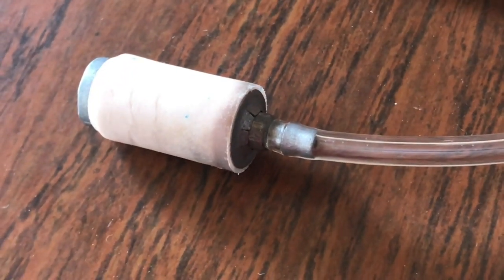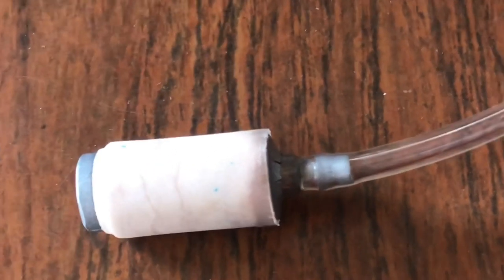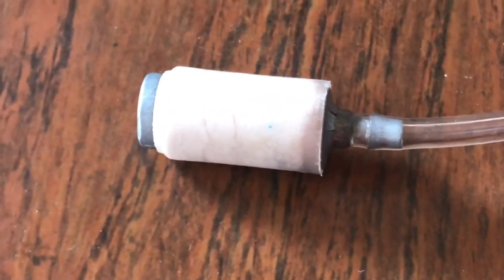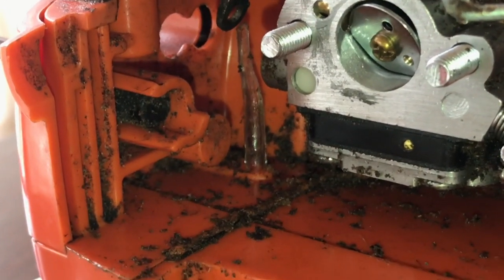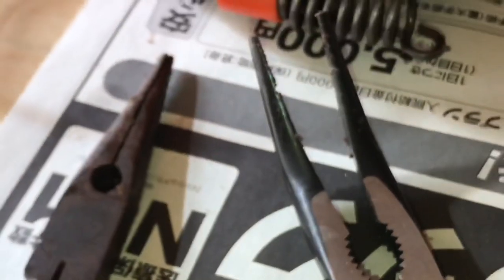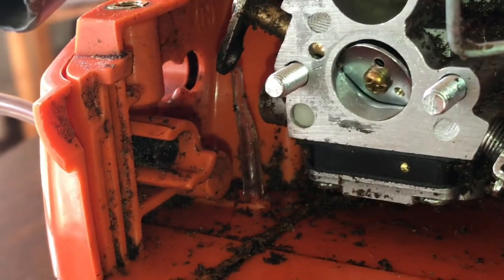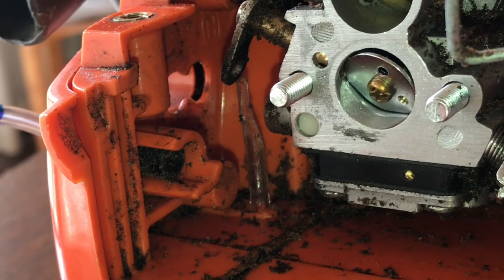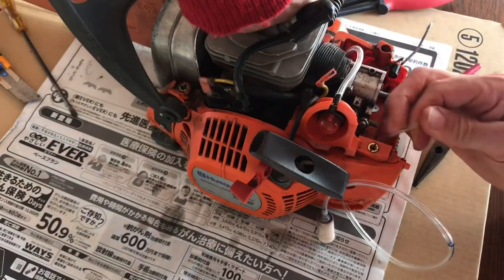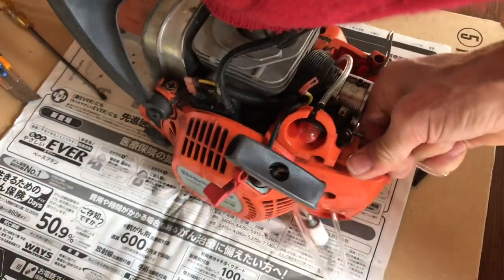Now with the new fuel line firmly attached to the fuel filter, we're ready to pull it through. I've only got it up that far — it is such a tight fit. In order to pull it through I've used these tools one behind the other: pull up and grab the end of the slack with the other one and just follow one behind the other. That is such a hard pull. I'll keep at it. Oh, it's coming. It is.